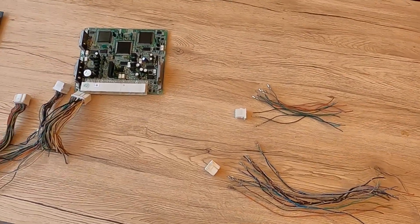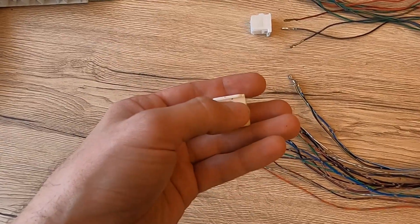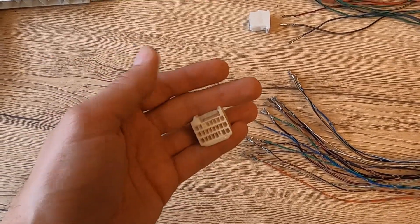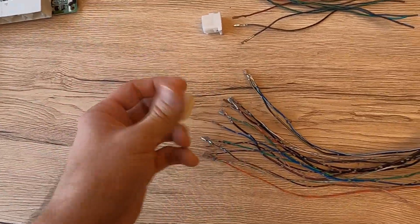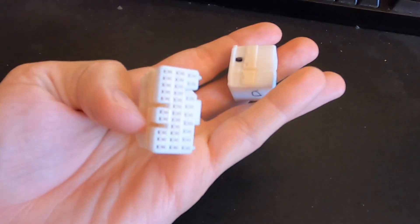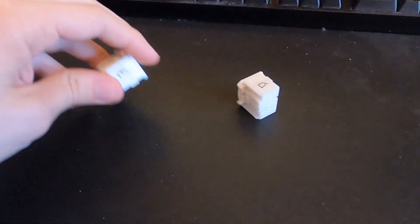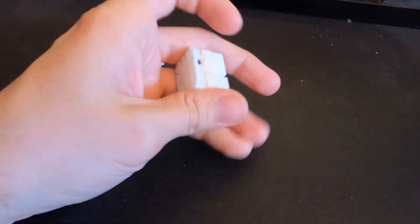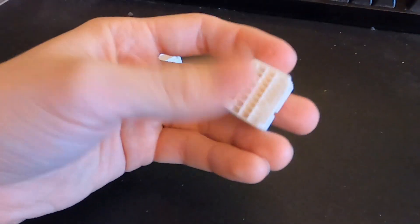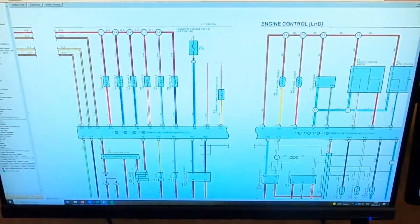You can depin these by just lifting this part — when you lift it, you can take the pins out. They are quite tight but they come out when pulled. I decided to use these two connectors, which should be plenty for the Speeduino pins — in total they have around 50 pins. I'm going to use the E-pin and D-pin as marked in the service manual and populate them with appropriately colored pins, which will be much easier to troubleshoot since they'll be the exact same colors as in the manual.